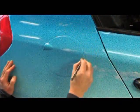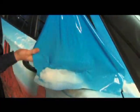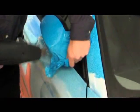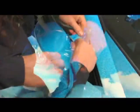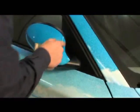Utmost care should be exercised in cutting the vinyl free and working it in at the fuel tank lid. Special care is needed in applying hot air to the vinyl as it must be bonded very firmly to prevent fuel from getting to the adhesive surfaces and detaching them. When applying vinyls to an outside mirror, a vinyl should be cut with some margin remaining, the protective paper removed, the vinyl placed on the mirror and heated in large sections. The vinyl is pulled with some tension and firmly applied with a squeegee. This operation is repeated several times until the mirror is completely wrapped. The remaining vinyl is carefully cut off — it's important to always work from gaps, never cut right on the paintwork. It's essential to preheat the cut edge and work it in.